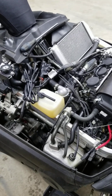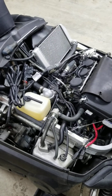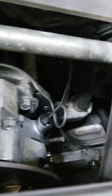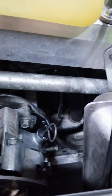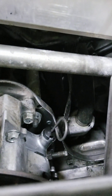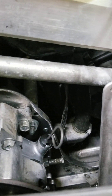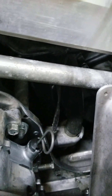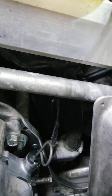It's been plugged in here for about 25 to 30 minutes. In case you're not familiar with this, the heater is an inline heater — they specify to put it in the coolant line. That block down there is the heater. I won't touch it because it's hot. It heats this cooling line which has engine coolant in it. The problem is that heat rises — it's like convection in air — so the hot antifreeze rises up the line. The theory is it develops almost like a heat pump, drawing cooler coolant in the bottom and circulating it through your engine.